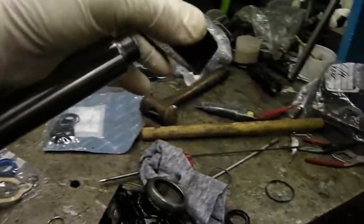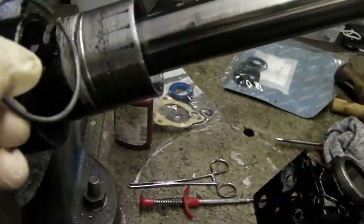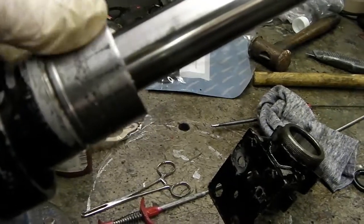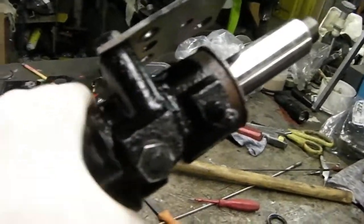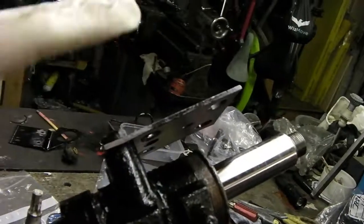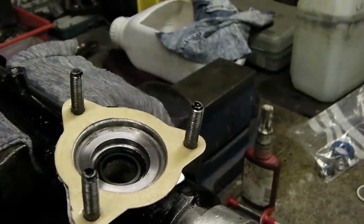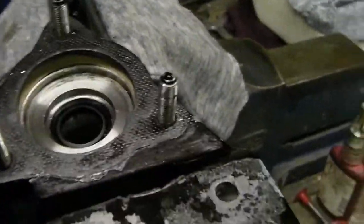We're almost ready to put the end cap back on. First fit the lock ring loosely, then fit the pin — the circlip fits in this ring and pulls against it when it locks in place — then fit the end cap. I tend to put a bit of grease around there when fitting it because it tends to go rusty around here. The locking castle nut should be left loose because you have to adjust the fittings on the rack to match your car. Now let's fit the tower — I put the gasket on there with a bit of clear RTV instant gasket sealing cement. Here's the tower bracket, which only goes on one way; next gasket goes on, then we'll fit the tower.